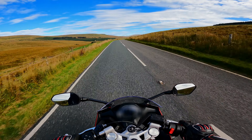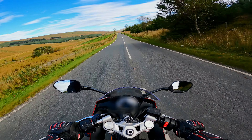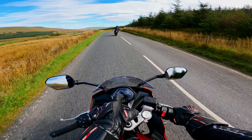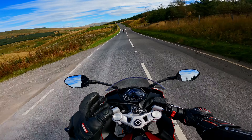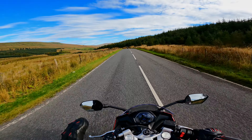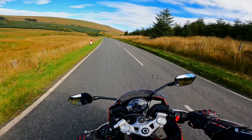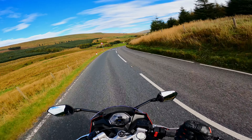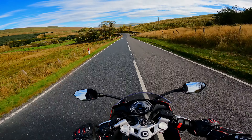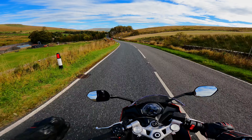You can get up to silly speeds with this engine. The 660 triple engine is a thing of beauty — the power comes through so beautifully at the top end. It's good to crank it over 6,000 RPM now and then to open the engine up, as long as it's warm enough. Don't just keep it pinned at high RPM — work the engine through its whole range, and that's the best way to run a bike in.